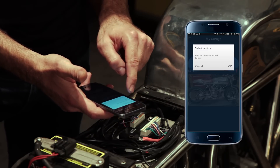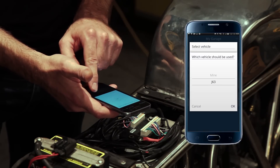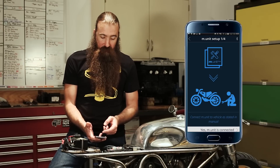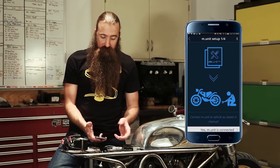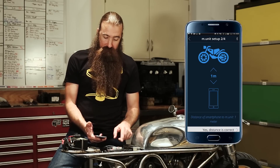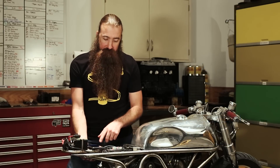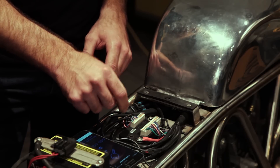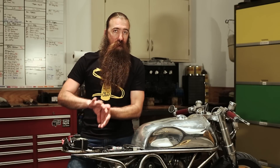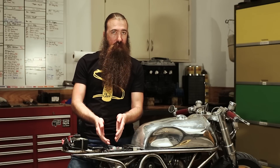Select which vehicle — I've already updated a couple of vehicles, and in this case we're going to do J63. Now it's going to walk us through the exact process: connect the M Unit to the vehicle as stated in the manual — done. Distance less than one meter — done. Now we need to switch it on. For this you do need a manual connection to the lock input, like an ignition switch. If you're planning to use keyless go primarily, you don't have to install an ignition switch, but you do need a temporary connection for the lock input to provide 12 volts.